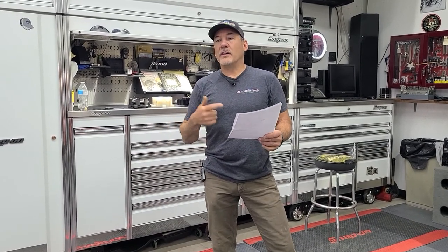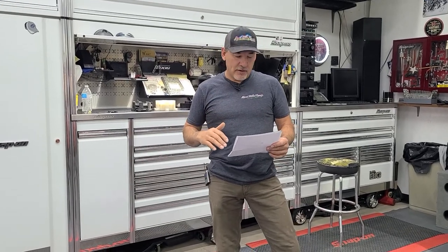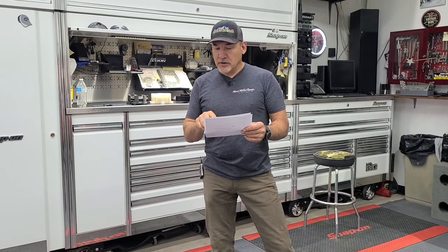Just to throw the other ones out there: a Pro RMK, say 2013 to 2015 with a belt, used a 21 and a 44 with an 8-tooth 286, and was a 2.077. It's interesting that the OEMs in that era were definitely over-geared, so it's very common to gear them down. But as we move forward in time, gear ratios have inherently moved to lower and lower ratios on the OEM level. A Summit Expert 850 154 uses a 21/51, which was a 2.429 in the gears, but with its driver correction it renders a 2.249 final drive ratio.